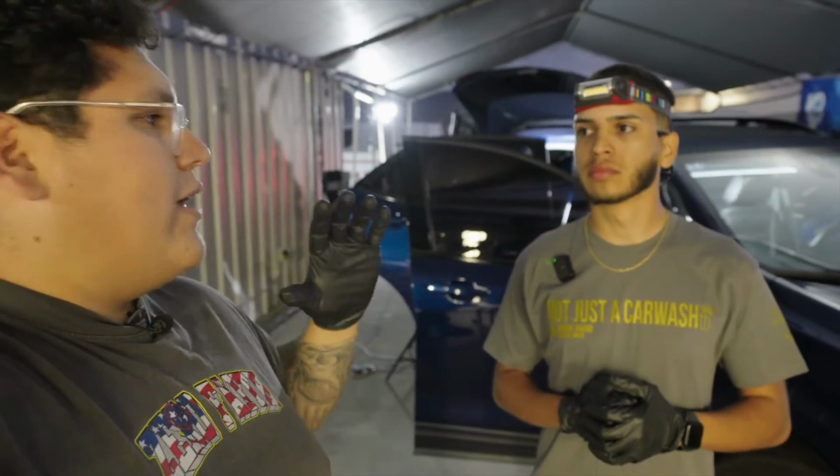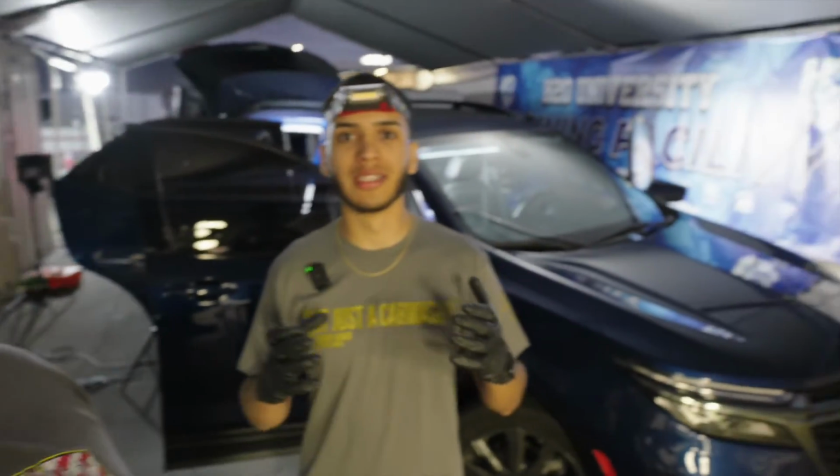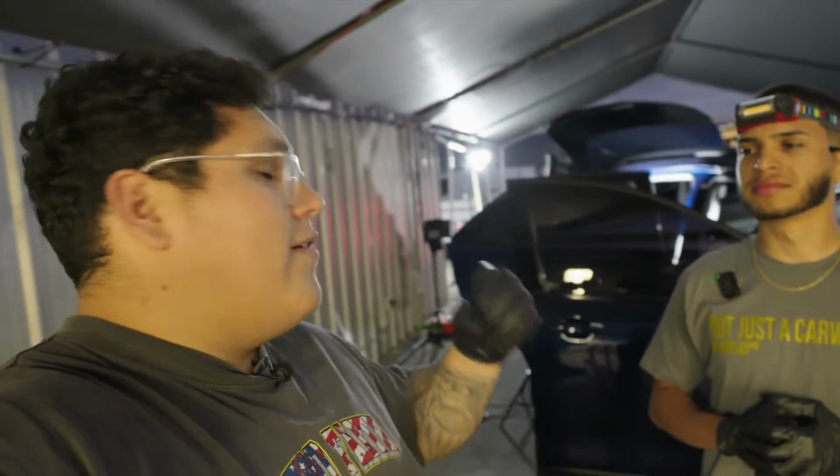And now we haven't added any protectant, nor are we going to add any protectant. But from here, we're going to go ahead and use extract solution and finish it off with finisher from PNF. To make sure we're neutralizing all of the cleaners so we don't leave any cleaners behind and then it'll reactivate later on and pull up old stains. So we want to make sure that we finish off the carpets and make sure that they are completely neutralized. Of course. So we're going to do that very quick.